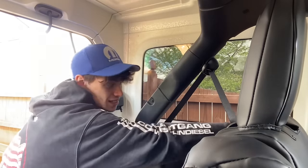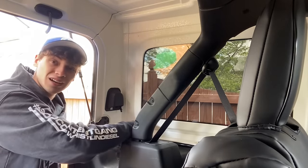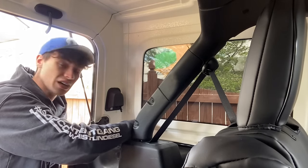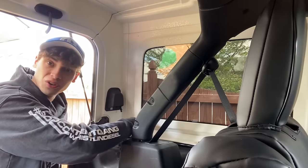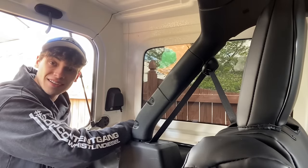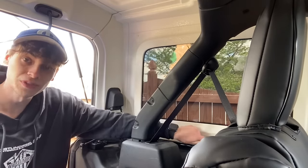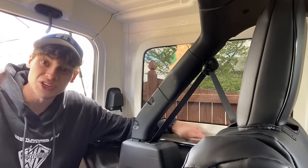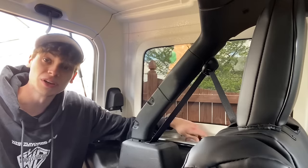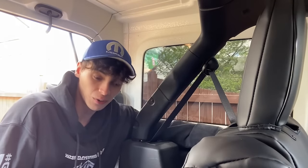One thing I will say is that typically, depending on where I live at the time, I'll usually set up some kind of harness or pulley system and basically just attach it and lift the top off. Now I know that depending on where you live, that might not be a possibility. I've even done it on trees using a tree limb. Essentially all you do is run a chain, rope, or ratchet strap around a tree or around a rafter in your garage or building, and you just back into it. After you get all these bolts taken out, you find a couple of decent anchor points, hook up the top, ratchet it up with a pulley system, and then drive right away from it. That's extremely easy and usually what I prefer to do, but what we're going to do today covers the basics — even if you live in an apartment.